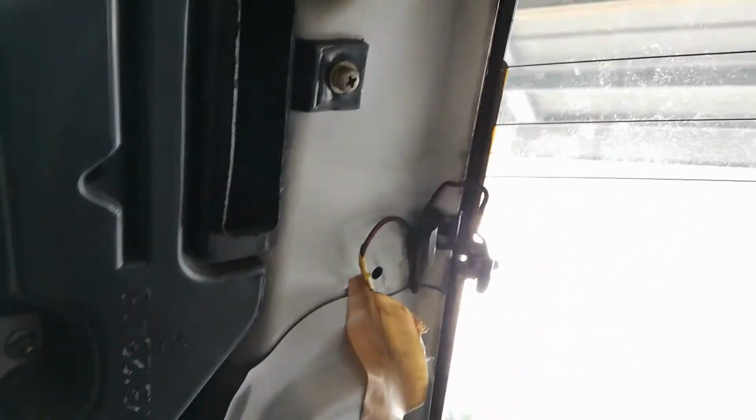Okay, the next thing I think I have to do is get this rear pillar trim off. Now this, according to the manual, should come off quite easy. There's 3 clips behind here. You can see them on the other side: 1, 2 and 3. But I had an immense amount of trouble getting this off. Mitsubishi say they have a special tool for this, but I just got my fingers in behind here and it was very difficult, but popped it off like that. So I'll go ahead and do the rest of the 3, pull this off and show you what it looks like behind there.